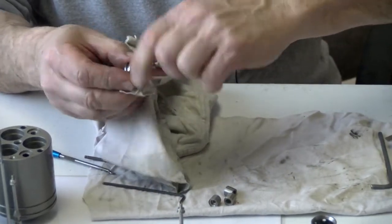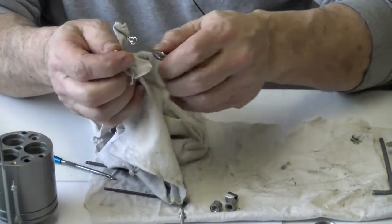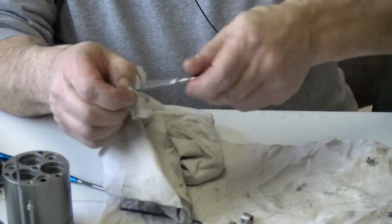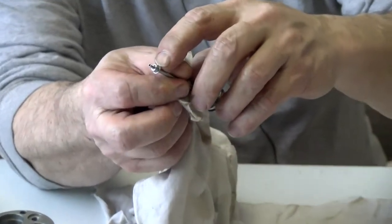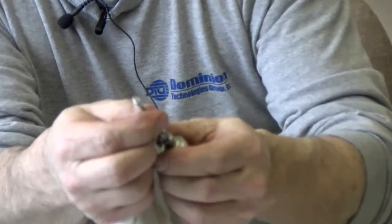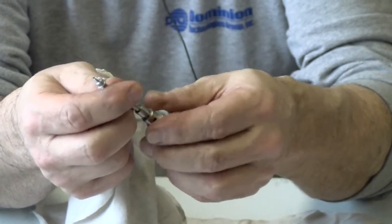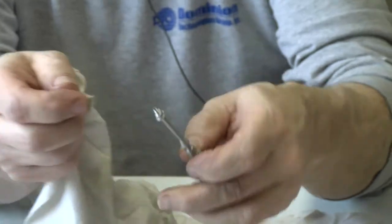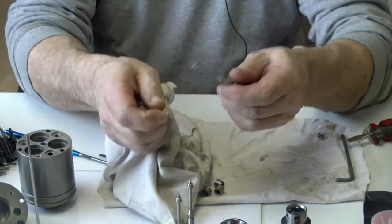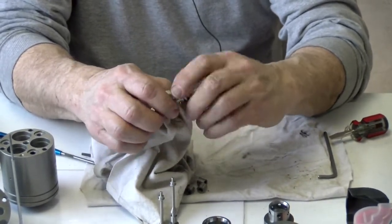They look pretty good. The threads look pretty clean. You can see the threads right here are really small. It's like a 440 thread. It's where that Allen nut goes on and attaches the retainer, the seal retainer on the spool. You've got to be careful when you tighten those up, because it's such a small thread you could break it, just twist it off with too much torque.